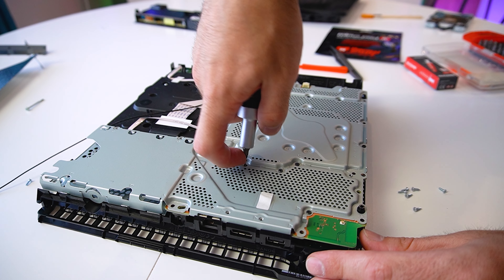And we can finally take a glance at the PS4's APU. This APU is a single chip that combines an AMD Jaguar 8-core CPU and AMD Radeon-based GPU, as well as other components such as a memory controller, video decoder and encoder. It's an extremely power-efficient APU and it's remarkable to see all that power packed in this tiny little mainboard.